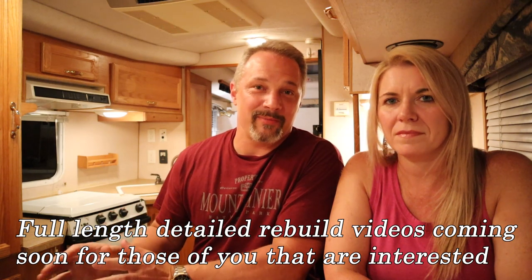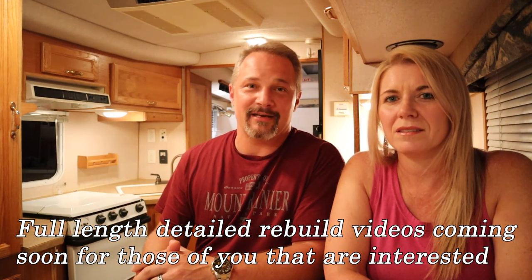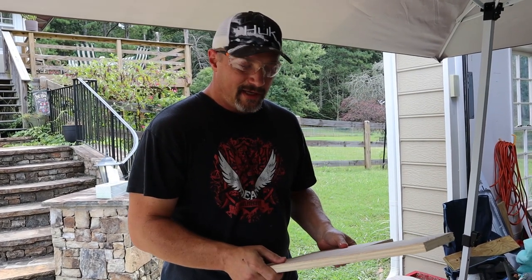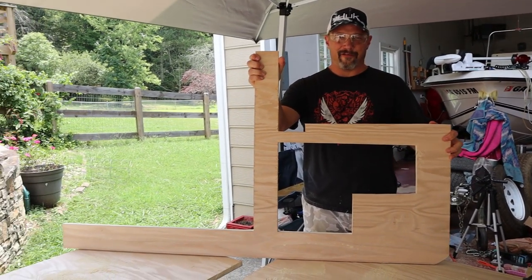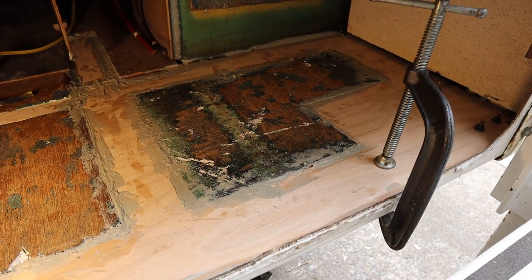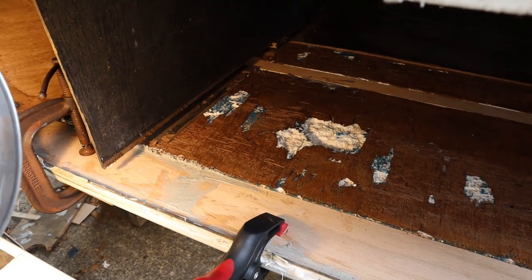On this episode I've basically been rebuilding and putting it all back together. I got some oak plywood — it's super stiff, very strong, not going to flex like typical plywood. It's three-quarters of an inch. I made a template, cut the frame for it — there's our new floor. I got some Loctite PL 8X adhesive, which is supposed to be eight times stronger than standard construction adhesive. All the plywood is in and glued down; I've gone through five tubes of that adhesive so far.